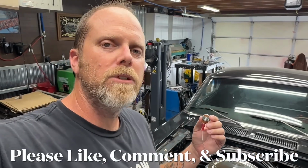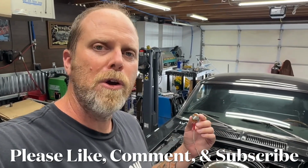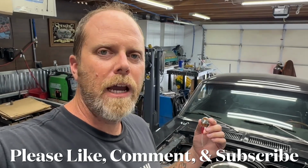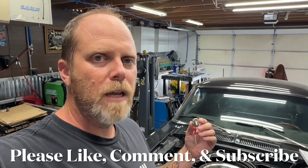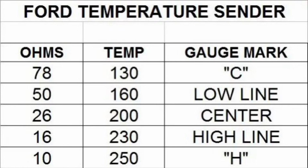So Ford temperature sending units, the one that this engine takes is a standard part number TS24. If you look at the application guide for that, it's from like 1965 all the way to 1997. So Ford used the same temperature sender and the same ohm scale forever. So what you need to know is 78 ohms is cold.